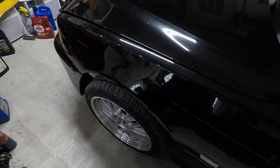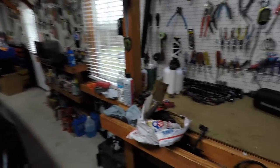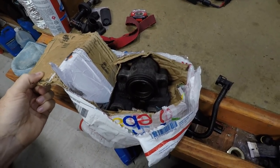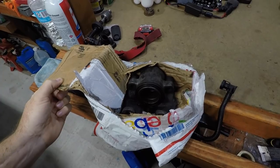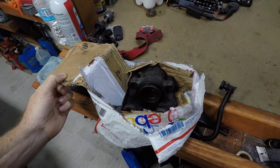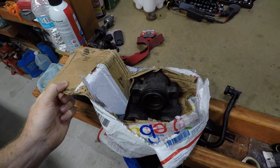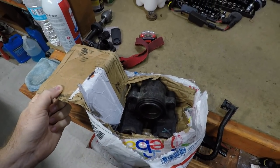When I was doing the engine, and then the other day I parked out front — when I put it in park and it rolled forward a little bit, it sounded like the brake was on. So when I was doing the fog lights I jacked it up and, lo and behold, the front driver's side brake caliper is sticking. We have a new-to-me brake caliper, got this from California off eBay for about 30 bucks with free shipping. We know California has no rust, and we know the only reason these calipers usually go bad is because of rust.